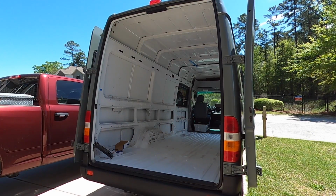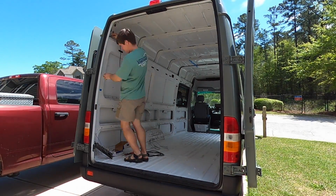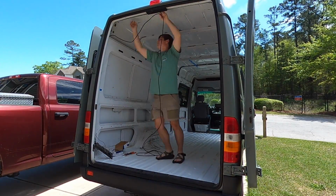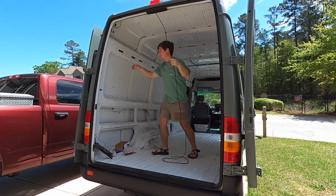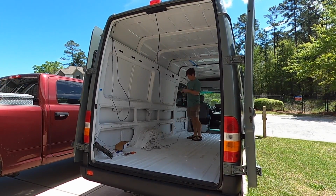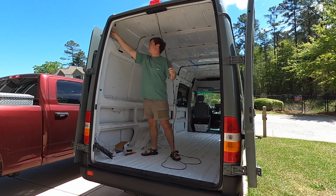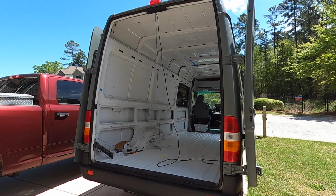So we also purchased an Alpine backup camera, which we'll put the link to both of those items in the description below. And if you're looking at buying one for a T1N van, they will say that it will not fit, but it will if you buy a single din cage to go around it and bend the tabs to make it work. So it's fitting in our van and it works great. It's an awesome radio. I would put it in again if I had to. So we're getting the wiring done here.